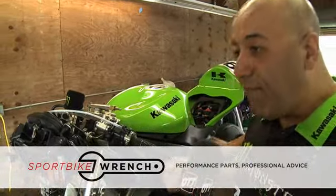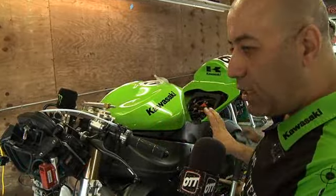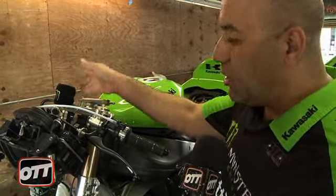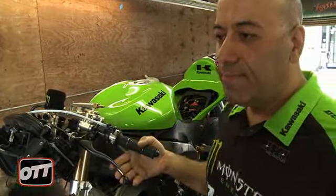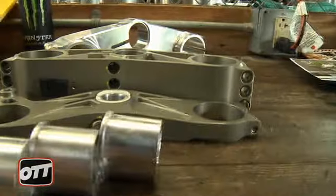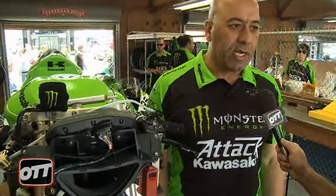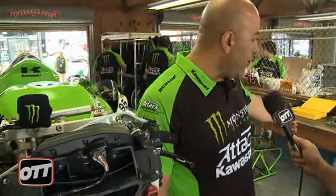So as you want to change your handling, you can just change this fore and aft. After you get your bike really close and comfortable and want to play around with something just to make it change direction better for one track or make it more stable, just change this — it won't affect your grip. You buy your aftermarket triple clamps which come with these little offset inserts that allow you to do that. We sell a variety of different offsets based on application because we make them for all motorcycles — not just Kawasakis, Hondas, everything.